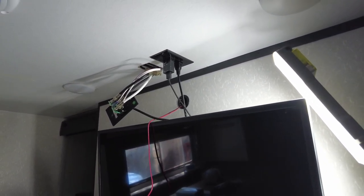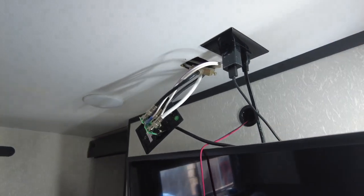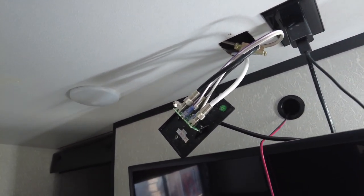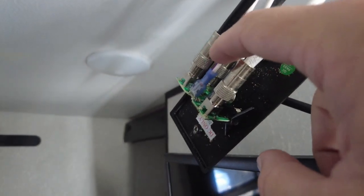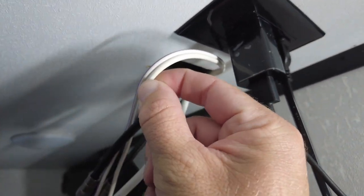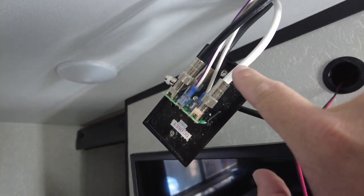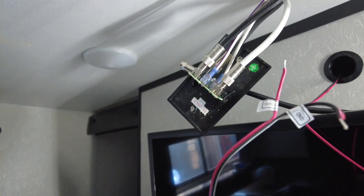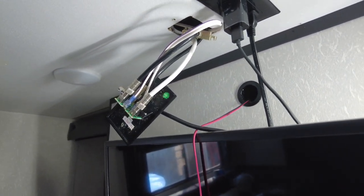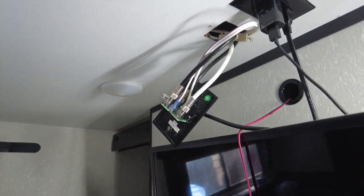This is not a tutorial on how to do this. Since it is 12-volt, I took off the little antenna for the television and looked back here on this circuit board with my power all off. This one here is my power and this one here is my ground. The plain white one is ground and the purple-and-white is my power. My plan is to just tap into those — splice in my power and my ground using these same wires — so they've got 12-volt power whenever I turn them on. I'm going to use my little WAGO connectors and just simply cut it.